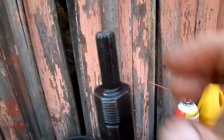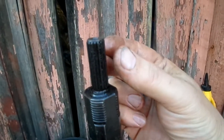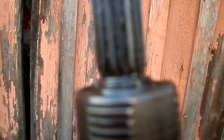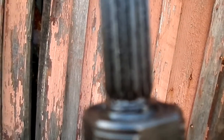To test it, all you're really doing is turning that lower shaft. If everything's lined up and working correctly, this will work like an agitator — you'll spin that nut down below, it'll go one way, pause, then go the other way, and the whole time you're turning the nut below in the same direction without reversing. It's going both ways with no binding at all — it's real smooth. All I'm doing is turning that lower nut clockwise with my other hand.